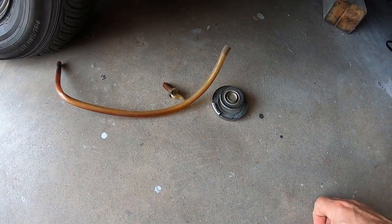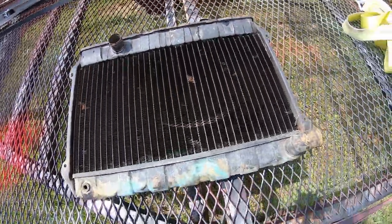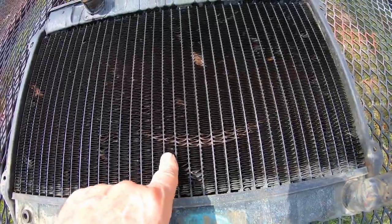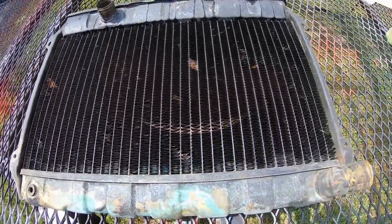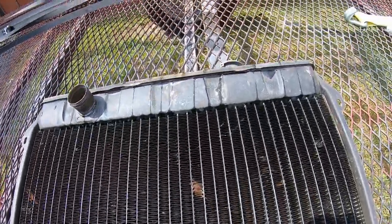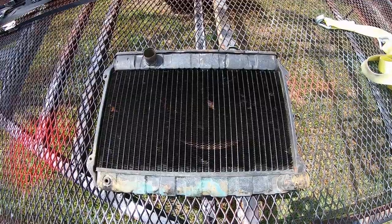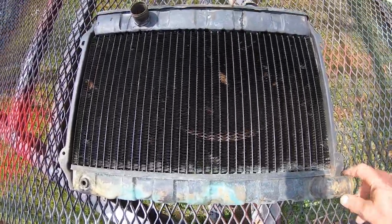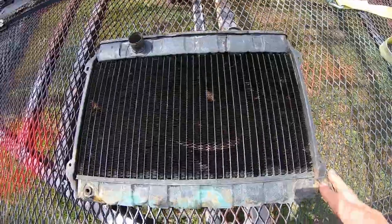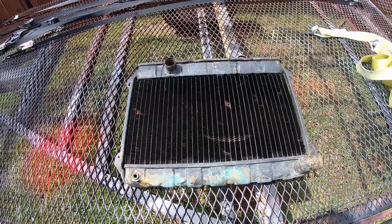Here's the original drain — I need to find a rubber washer. I think this is the original cap. Here's the original brass radiator. I'm trying to clean it on the grass and inspect it to make sure there's no damage in the tubes. These fins are so big I could actually bend and straighten them. It definitely needs paint because the paint is all flaking off. It's got a 90-degree fitting at the bottom and bolts on the firewall for support.